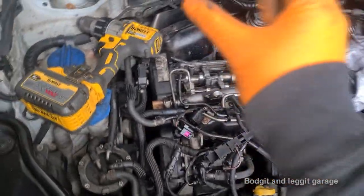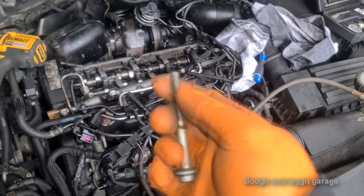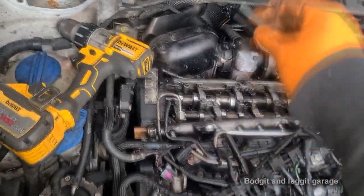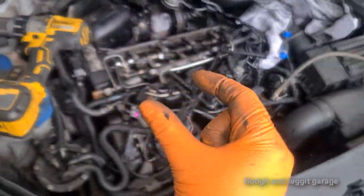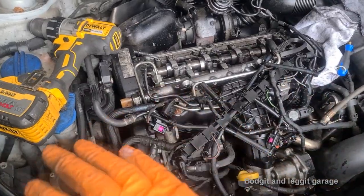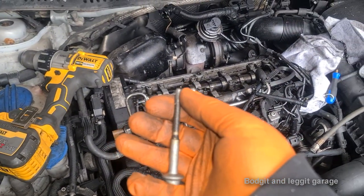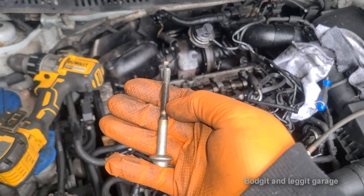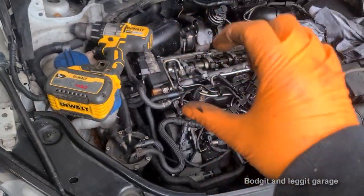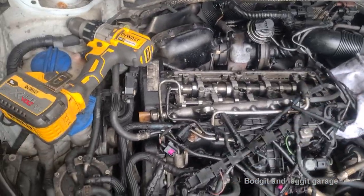The problem is, when you've got a long bolt like this, the helicoil kit only goes so far and you can't stack two or three next to each other because they don't like it. I couldn't find a longer helicoil anywhere, and even if I could it would take a couple of weeks to arrive. So what I've done is put one helicoil at the bottom and one at the top — there are threads missing in the middle, but at least that way we get a good bite at both ends and it should be absolutely fine. Fingers crossed, that's all I can do.